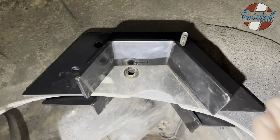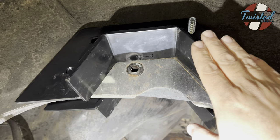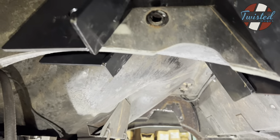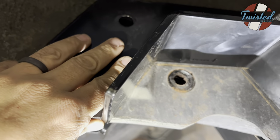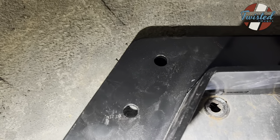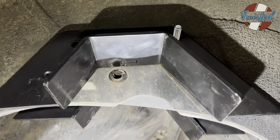What we've done here is took the notch and bolted it to the outside of the frame rails temporarily, with the one that will actually go on here on the inside. This lets us bolt it in place with the two existing holes already in the frame that were for the cross member. We bolt that in snug, get it in position, and then mark where we're going to cut — actually cutting a quarter inch above the lines to account for the thickness of the material, since this plate is going to go on the bottom of the cap off the frame rail we're cutting out. Once that's cut and we can bolt this in tight, we mark the two remaining holes and it bolts in completely.